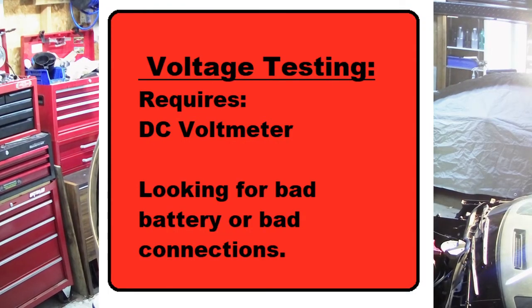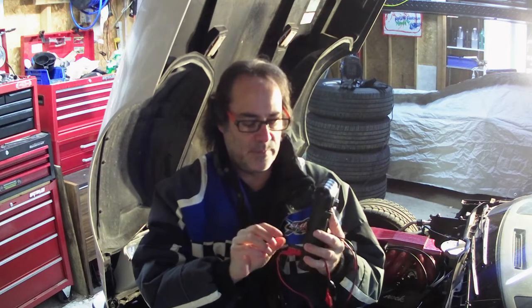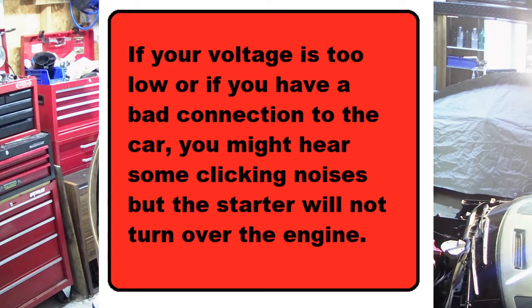One of the other things that a car needs to run is voltage. You need some energy coming from your battery. If the battery is too low, it will not fire off relays, it will not properly power computers, it will not start the car — there won't be enough energy getting to the starter. So what you need for a simple test is a voltmeter. You're going to put the voltmeter to measure DC volts and go directly to the terminals of the battery.